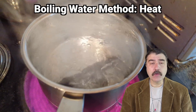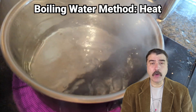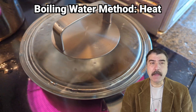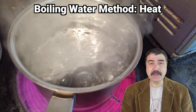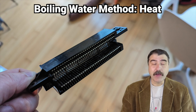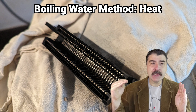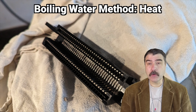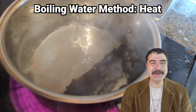The method I used here was to boil the 72-pin connector in water on the stove for 5 minutes. Take the removed connector and bring a pot of water to a rolling boil on the stove. Then submerge the connector and let it boil for about 5 to 10 minutes, making sure to move it with tongs or chopsticks to ensure that the plastic part of the connector doesn't start to melt. I boiled mine for about 5 minutes and set a timer. Then I removed it from the water with tongs, making sure not to touch the hot metal — remember, hot metal looks an awful lot like cool metal. Then take a cleaning cartridge or inexpensive game and plug it in and remove it a couple of times to add some mechanical force to remove any remaining corrosive residue. Let it cool and dry before reinstalling it, and dump out the water and wash your pot so it doesn't taste like 37-year-old metal ion residue.